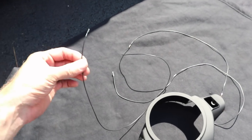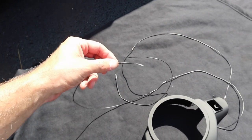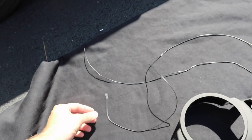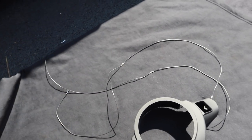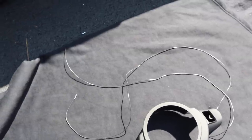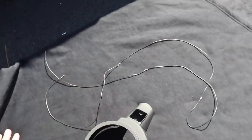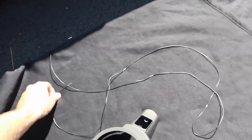Typically when you're doing this, we're going to be installing one of these wires by your passenger footwell and the wire needs to go all the way up to the steering wheel, where the other end connects. You need to buy two of these wires — you can see I need some soldering — and then about 18 inches of wire in between. When I bought these I got four for the price of two, so I cut the ends off two of them and soldered all four together. You don't need four though; you could always just get some 22-gauge wire and solder it all together so it's nice and long.